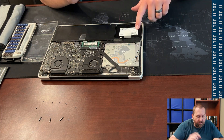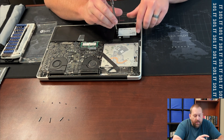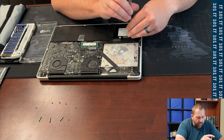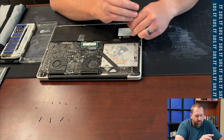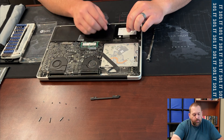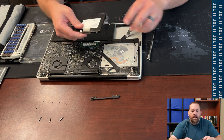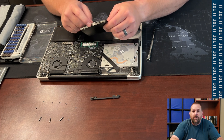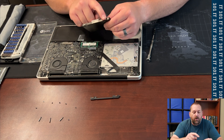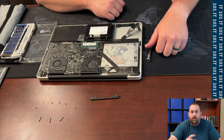I am going to take the screwdriver and take these two screws out right here — they actually don't come out, you just loosen them. I am going to loosen them and they will stay on the bracket, then this little bracket comes out which I will set to the side. Now I can just pull the solid state drive out and disconnect the SATA cable. All you have to do is transfer this little cable over to the new solid state drive or hard drive, then take out these four screws and put them on the new one, and we can put it back in.